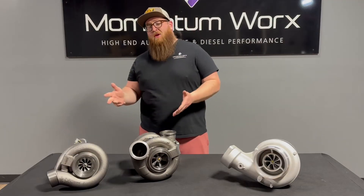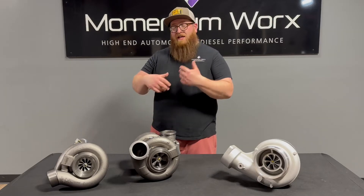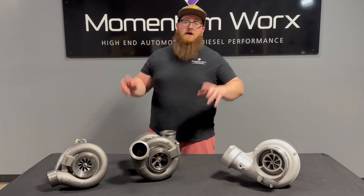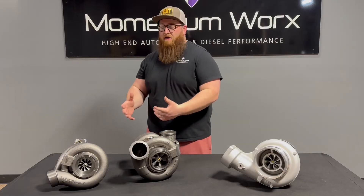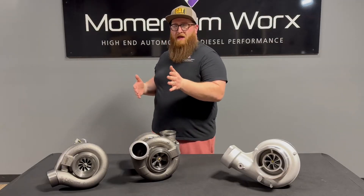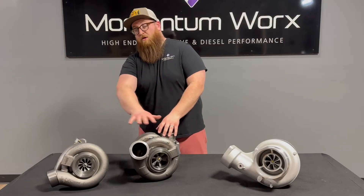Through the middle and top end of the power band, that's when your low pressure turbo starts to get spooled up — and that's where you get all your mid and top end power. The low pressure turbo will then blow through the high pressure turbo, thus compounding boost. That's how these turbos work together to make power. They're not twins, they're not sequential, they're compound. A sequential would be a little and a big, each going direct. Compound means the big one blows through the little one.